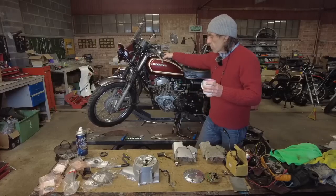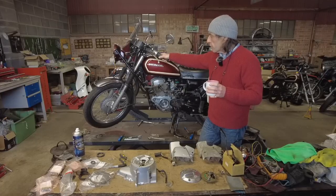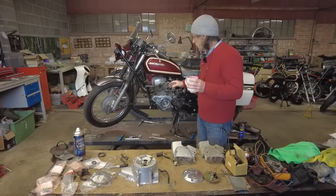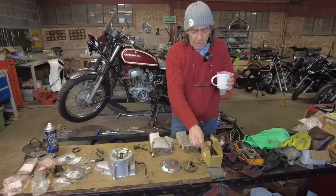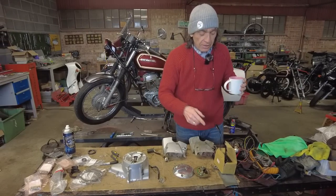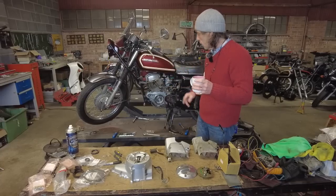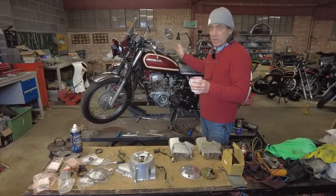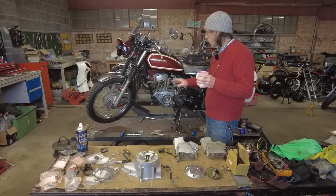Because I need it every day I thought I might as well get involved and sort it out properly. We haven't filmed it because I was doing it in the middle of the night. So what have I done so far? I put a new ignition coil on - here's the old one. I'm only suspicious of it because it was a bit damp. I've got one on the shelf; they're £19 from David Silver Spares plus VAT. A new ignition coil rules out any skullduggery there - well worth doing if you're not sure, because there's no real way of testing one apart from measuring the resistance and that's not foolproof. That's got the new HT leads and I've got new NGK plug caps on it.